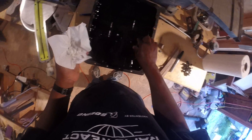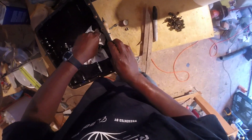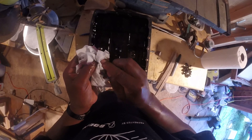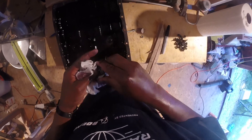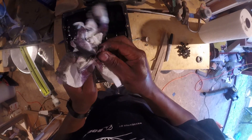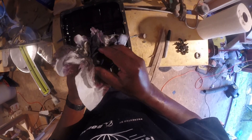We are in the shed and I am cleaning off these magnets. Here's what you do — you just wipe them off. I suppose I could use some brake clean. The idea is to get any metal out of there. From what I've read, there should be an expectation that there's going to be some metal debris, like metal dust — not too much, but that's kind of wear and tear on a transmission.